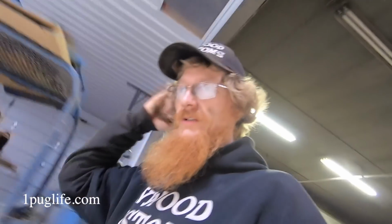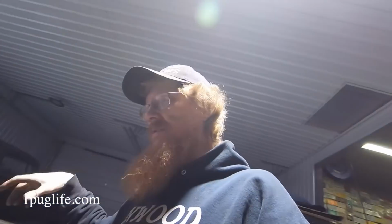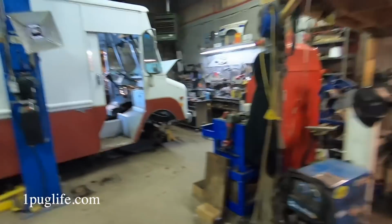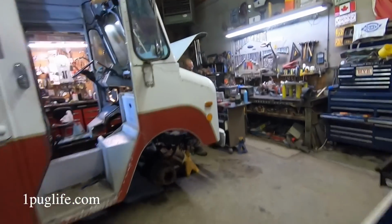Because, you know, I could just leave all the wiring in there and bundle it up, but really at the end of the day, if you ever gotta fix something, you don't want to have to jumble through a whole bunch of unnecessary stuff in your way. You literally need one wire to the power, and there's the distributor wire.